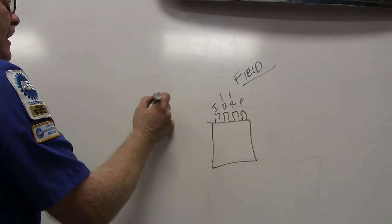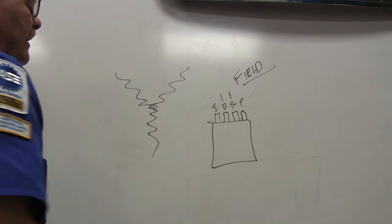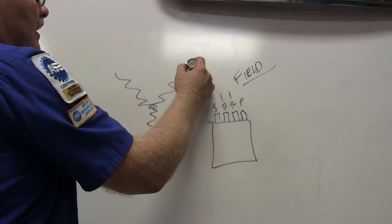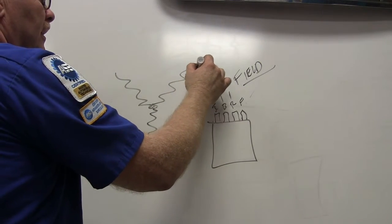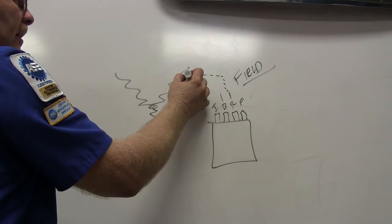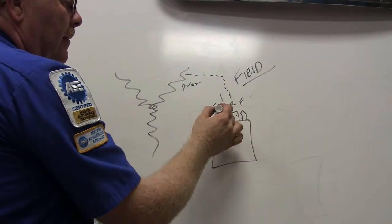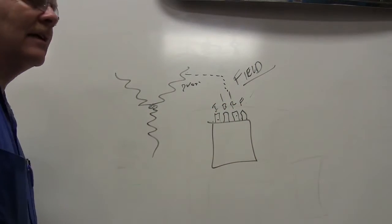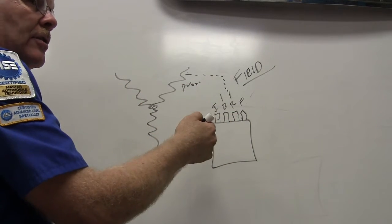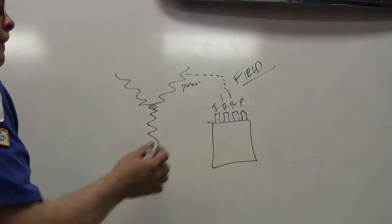There's a Y-wound stator too. They're tied together in the middle, but it's still got 3, right? Off of one of these is going to go to the R terminal. And you're going to have like 7 volts here. If it sees 7 volts here, then basically it turns off the light. If it does not see 7 volts here, it assumes the alternator is not charging and it turns on the light, even though the alternator may be charging, right? And that's the way that works.